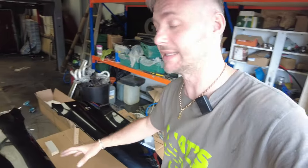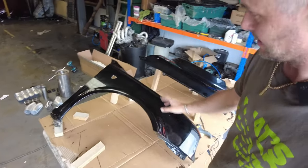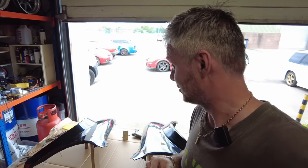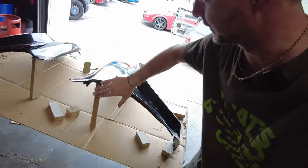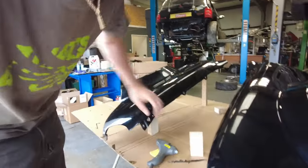Here are the wings from a Nissan Micra K11. They've been modified before with the wide arch body kit and they're super heavy — we just weighed them and they're 2.75 kilograms each, because of all the filler and everything. I reckon I can get each one down to under a kilo, so that's a good four kilogram saving just on the wings. I'm using a glue gun and some offcuts of wood to prop them up off the surface, because it's a lot easier to get to the edges when everything is slightly lifted.